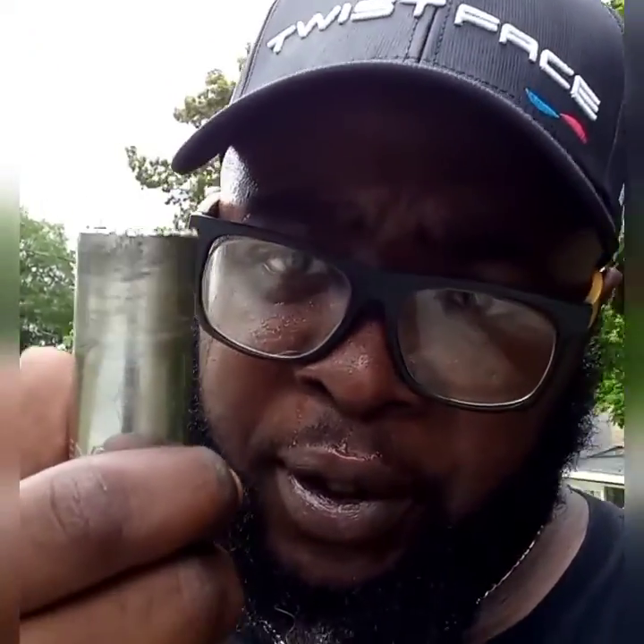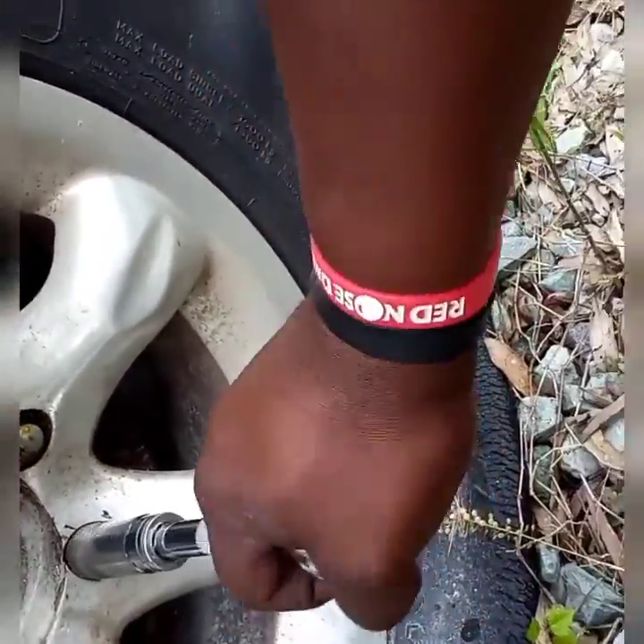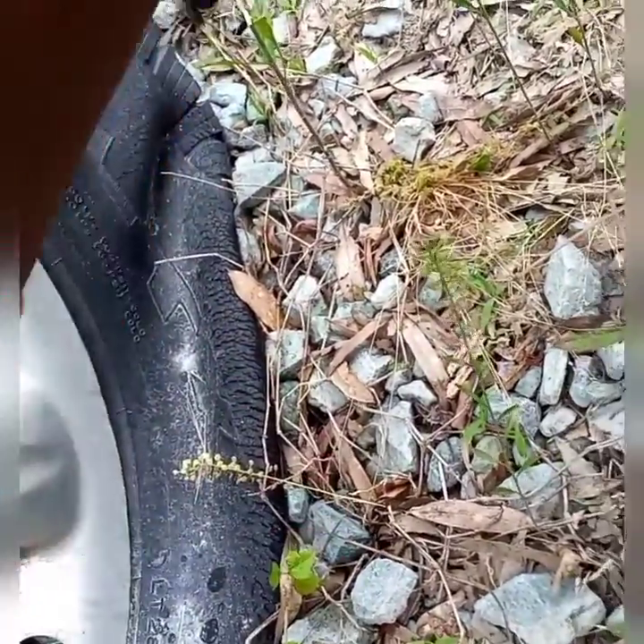Welcome back. I didn't give up — we don't give up at Think Big Videos. I didn't have to get any leverage. I just put a socket wrench extension in, and that's all you needed. I finally got it. I haven't changed a tire in a while. Shout out to AAA, but I had to do it myself this morning. These are 6-lug rims — 1, 2, 3, 4, 5, 6. I have loosened all of them up. Make sure all of them are loose. Don't loosen them so much that you're taking them off — just loosen them at this point.